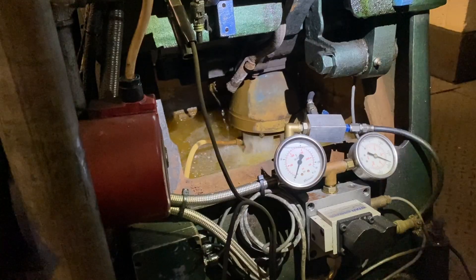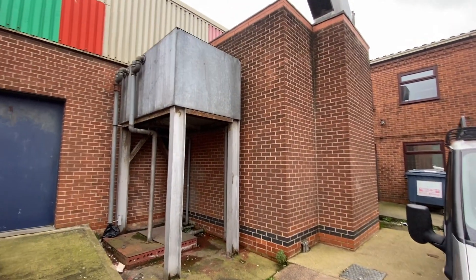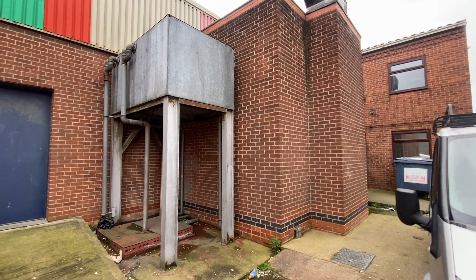There's the old debate about breaking an engine in. Normally on a conventional rolling road dyno you look for blow-by on the catch tanks - you watch it drop off and you know your rings are seating. But here, which is probably the better way of doing it, they use a very expensive borescope and check how much oil is getting past the rings to see whether they're fully bedded in. That also lets you see if there's any bore scratching. Outside you can see the giant water tank - I think it's 2,000 litres - the exhaust extraction, and the dyno room itself.